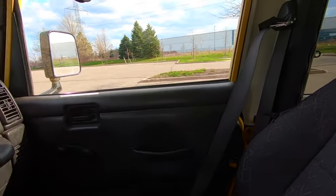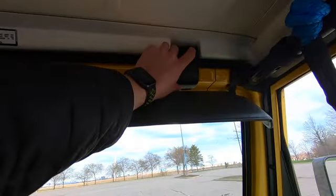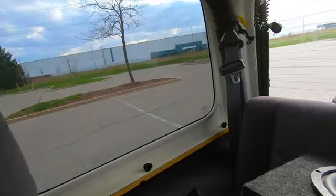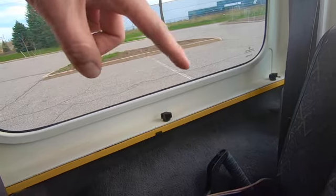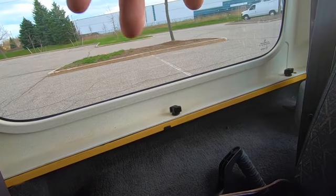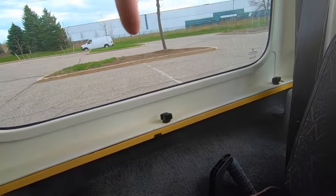And check your latches, see if it latches properly, see if it's nice and tight, see if it's actually working as it should, because a lot of the times people like to take these off and they don't take care of them very well, and these like to get bent and things happen to them. So just check your latches, make sure the latches work, make sure the latches actually line up and everything seals. Also, funny enough, I know it sounds kind of stupid, but check that all the screws are in for the hardtop. I know a lot of people that run these without the proper amount of screws or without even screws at all. I know guys that just latch it in and they just go for it. So make sure those are there.